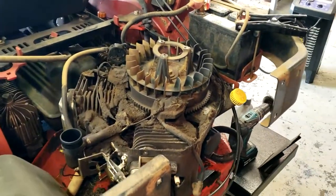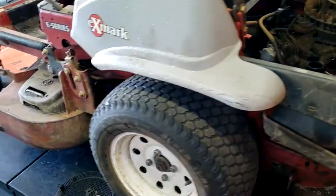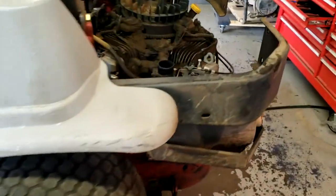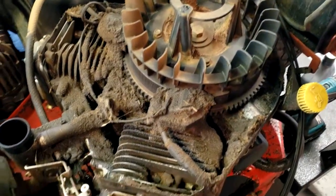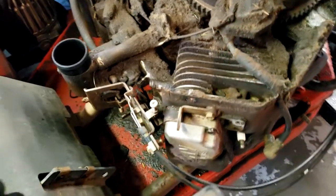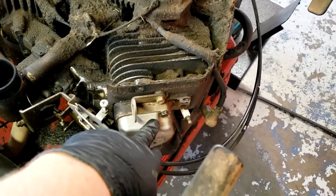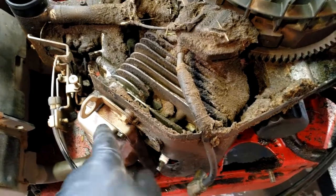And we were just talking about this one the other day. Well, here is an Exmark zero turn mower, commercial mower. This guy came in saying he was down on power. And what he's got going on, we won't get into all that right now, but he has a dropped valve on this side. A couple of bent push rods, so it's running on one cylinder.